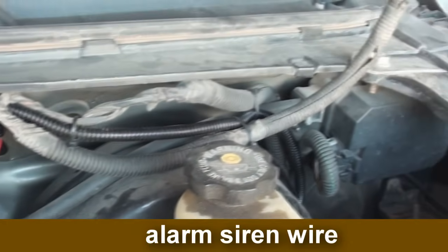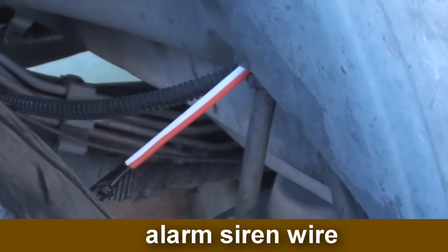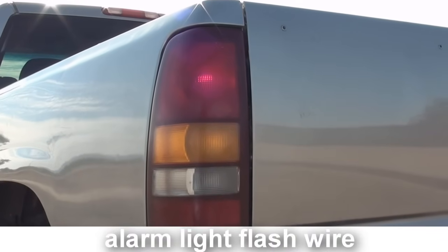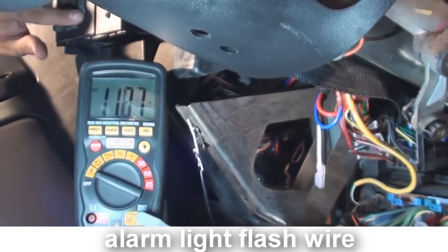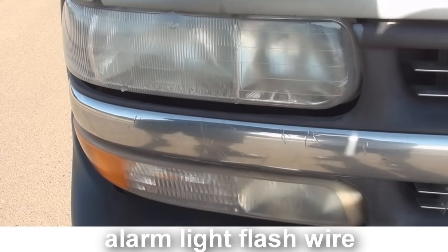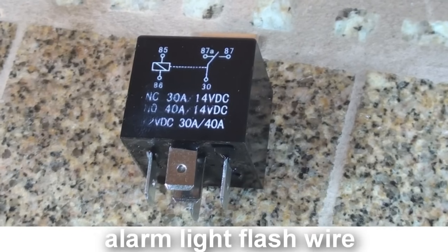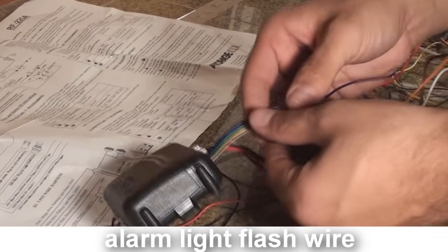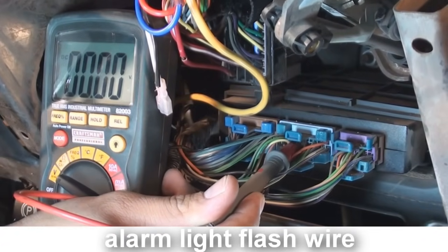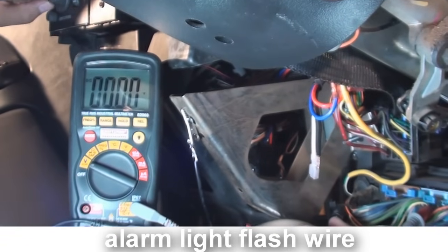When the alarm is breached, the siren output wire sends a positive output to the siren causing it to sound. This wire will run through the firewall and into the engine where the siren is located — connect this wire to the positive side of the siren using a connector. The parking light wire, when connected to a light switch, will flash the parking lights. This is a circuit in the vehicle that shows 12 volts when the light switch is turned to the on position. Most vehicles have a positive trigger light, so all alarms from the factory come with this installed. If your vehicle has a negative triggered headlight switch, then you will need to convert the output of the alarm using a relay. To test the circuit, make contact with the suspected circuit, turn the headlight switch on and off, and your meter should change voltage to either positive 12 volts or negative 12 volts. Once this wire has been verified, integrate into the circuit.